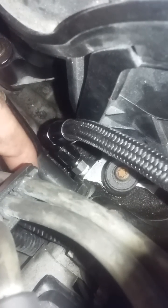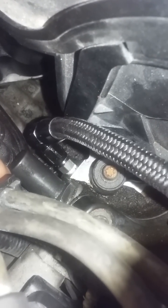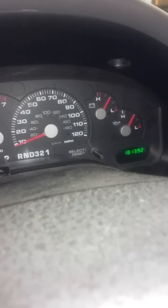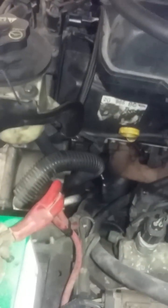This was a cheat for me because I only had to buy the T-fitting — I had all the other fittings laying around, the hose, all that stuff. Obviously this might cost you about $30 if you buy all this stuff new. Instead of having the rattle on cold starts that you typically get because it takes a second to get pressure there, now as soon as you start it, it's nice and quiet right off the bat. As the oil gets warm and thins out, that pressure will drop a little bit, but just let it warm up and the chain tensioner rattle is gone.